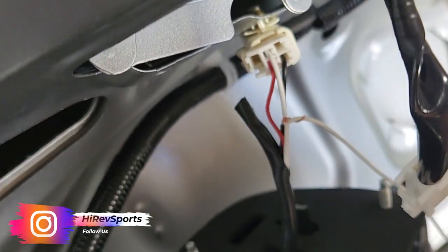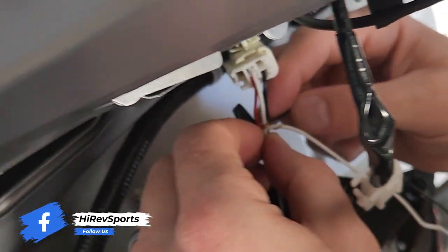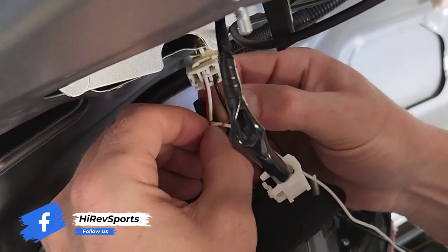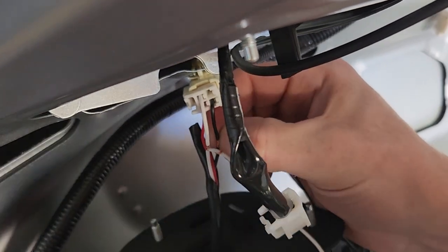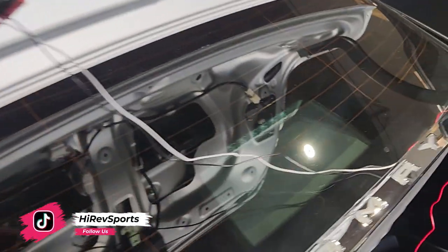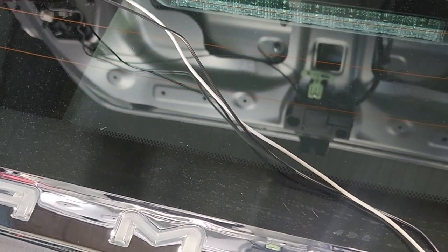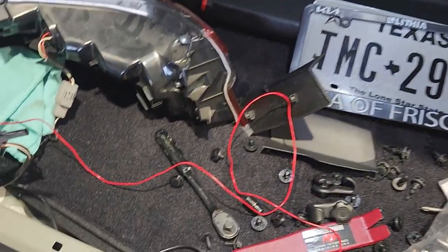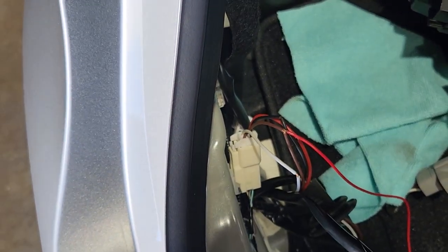This is the XSE installation — very easy, and if we can do it you can do it too. So once again, the wires coming out of that LED bar consist of black, white, and red. The black wire is the ground, the white is for the animation or parking/running light, and the red wire is for the brake light. We basically ran that red wire and connected it to the brake light wire on the tail light.